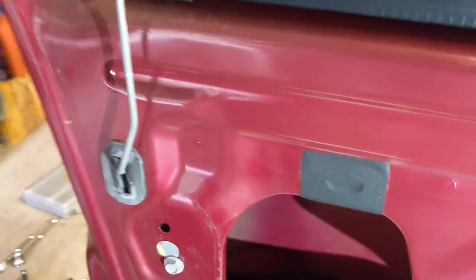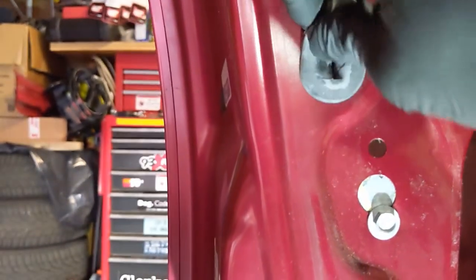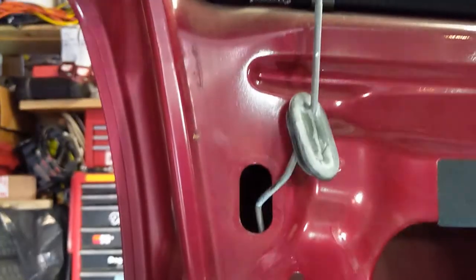You're going to want to pluck this rubber piece off and just kind of leave it. Inside there — I'll put the light in — you can see those two bolts. Those are going to need to come out; they're 10 millimeter. And there's one right there in the front that's also going to have to come out.